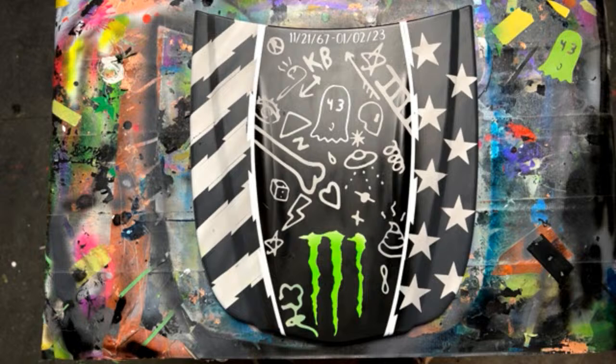Oh, another thing I want to add on to that. Say you're on a limited budget and you want to get some candy paint, and you're not sure what colors to get. You're going to want to go with the primary colors. So get gold, get red, and get blue. Because you mix blue and yellow, you get green. You mix the red and the yellow, you get orange. Same thing with purple: blue and red together make purple. So now you have the secondary colors too. You don't even need orange. You don't need purple. Make them.